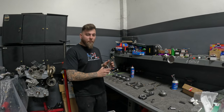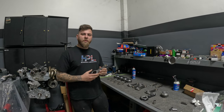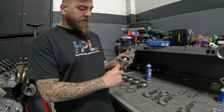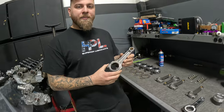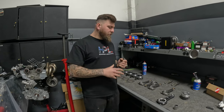So the more power you're making, the more you're stressing this out. There are a lot of other factors too when we're talking about knock and detonation, especially at high power levels — you can easily blow this thing right through. And when you have metal to metal contact, especially at that high of an RPM and load, you fuse this thing together instantly and just chuck a rod out of the block.